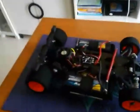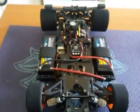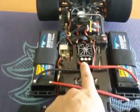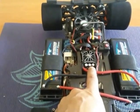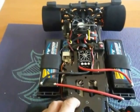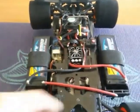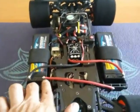Take a look here. Start off with just a basic, simple layout — take out all the engines and the guts. The speed control here is the Hobbywing XR8 150A. I'm only running 4S, but you can put 3S on each side and push it up to 6S. I'm not into a lot of wiring, so I like to limit my wiring. I've got the positive going to this side, the negative on this side, and the joint cable right here.